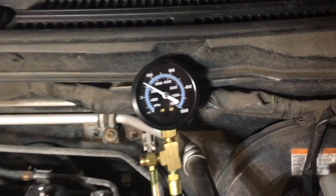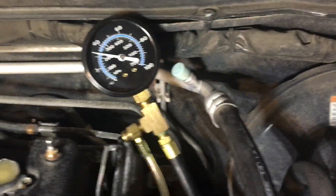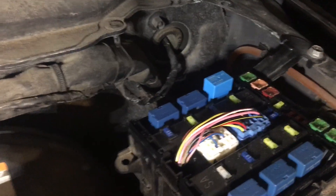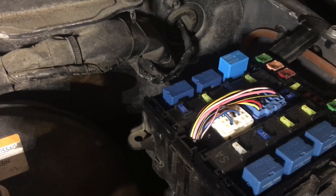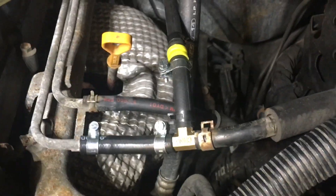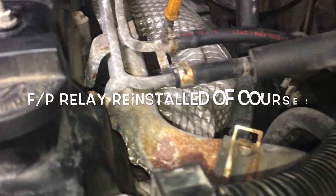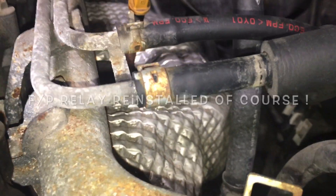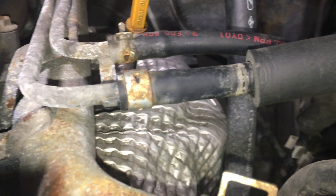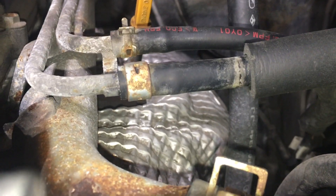That was the last cylinder. I'm going to disconnect the gear — to bleed the line down I'll pull the fuel pump relay again, let the system bleed off the pressure, then disconnect everything and put it all back together. Run the vehicle, leak-check everything after reassembly. Prime the system, start it, and make damn sure the connection is sound — especially since in this case it's right above the exhaust manifold.